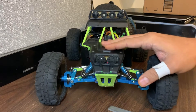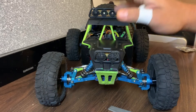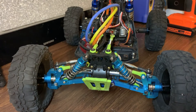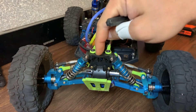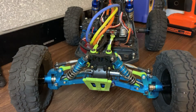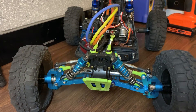Let's pop open the car and we'll see what it looks like actually on the car, and see the plastic one I have installed right now. Now that we've got the hood off, you guys can see everything. As you can see right here and right here, there are two gold screws, and that's what's holding in the bracket, with a couple of links right here and right here that hold it stabilized in place. One thing I need to mention is those two screws — they're not quite long enough, the original ones — so you're going to have to find replacements.